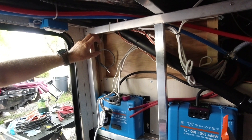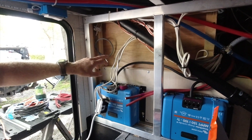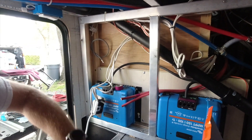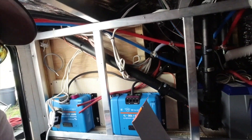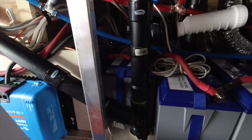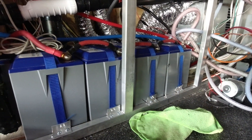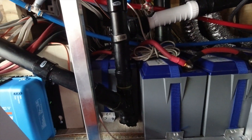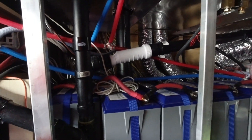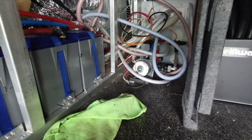There are the MPPTs — this wall will be put back. I'm going to have recessed switches and circuit breakers: these two are for the coach and these two are for the batteries going to the MultiPlus. The batteries had to be staggered a little due to the piping, but all six are in place and strapped down. End of day three — everything's strapped down. The 712 shunt is right there on the ceiling, and from there I'll disperse out to the grounds.